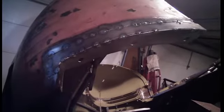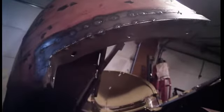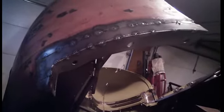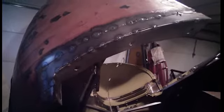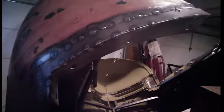So right now we're looking at the driver's side front fender, and a whole 1 inch of that fender was rusted off, and the whole entire flange that connects it to the running board was rusted off. And luckily the passenger side I at least had down to the corner, so I had something I could measure to try to come up with where the corner was on this one. And then I laid out the bolt pattern off the running board because the whole entire flange was off the other one too on the passenger side.